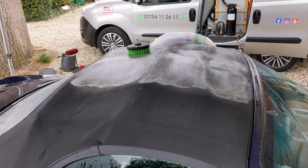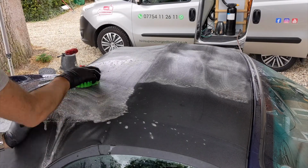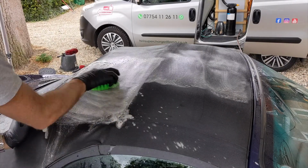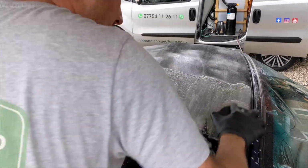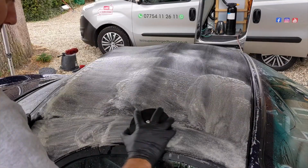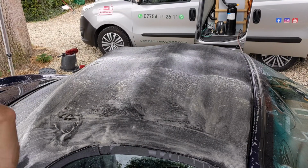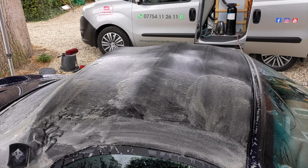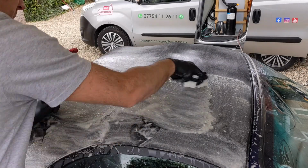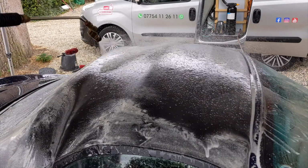So I'm going around that here, and what I found was, whilst it was very good for knocking off the heavy dirt that was well on top of the fabric, when you wanted to get into the weave, the bristles were too thick. So then I switched over to the tyre brush that I use for interior detailing. That has got smaller but stiff bristles, well, a bit finer when I say smaller, and they fit very well into the weave. And you can see here I'm going in one direction only, and that was with the direction of the weave in the fabric.